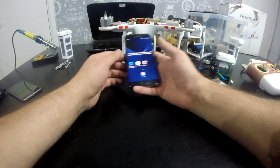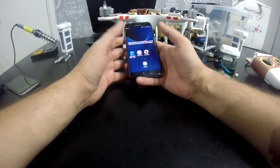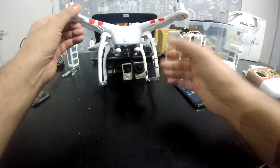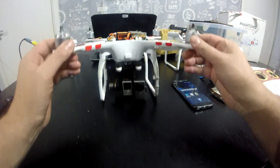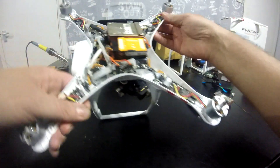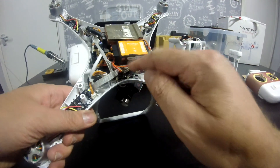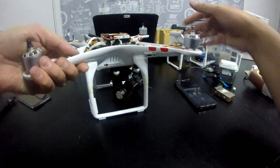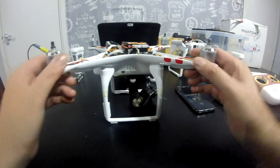It's a win-win and it's really good. I'm glad that I found this, and as I said I purposefully went out and bought this Phantom 2 with a Zenmuse gimbal just so I can test it. If you do decide to go down that path, all you will need to do is change the transmitter board here — this is a 2.4 version, so obviously you'll need to change that for the 5.8 version that you find in your Phantom 2 Vision Plus.